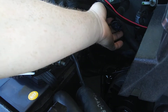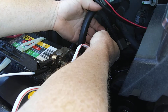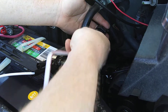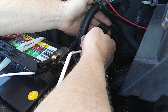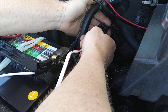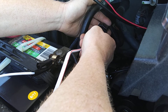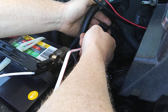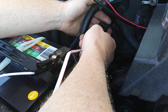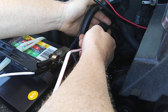There's the plug to the motor — if I touch these together, see that? The motor comes right on. That motor runs fine. But when you plug it back into the connector where it goes, it won't run. You can hear it running off the battery — it runs beautiful.